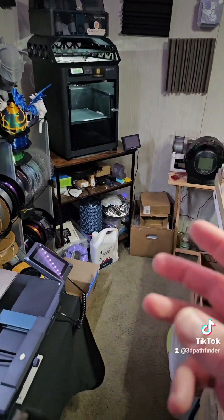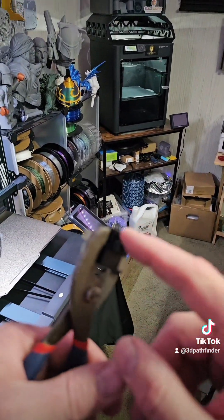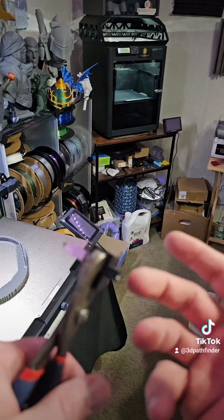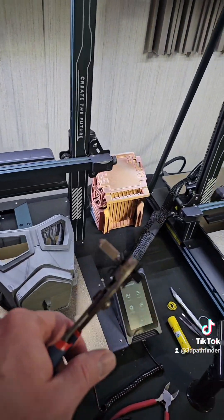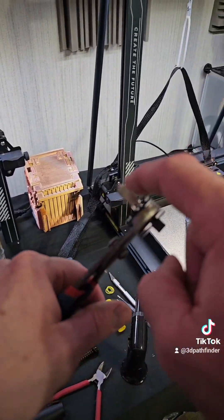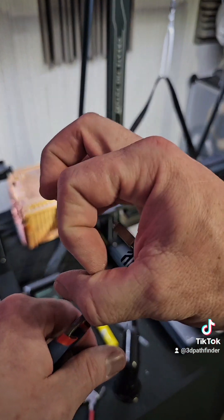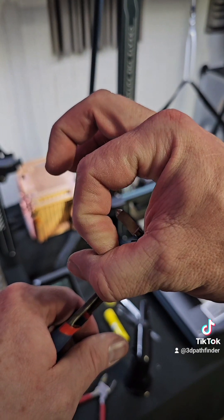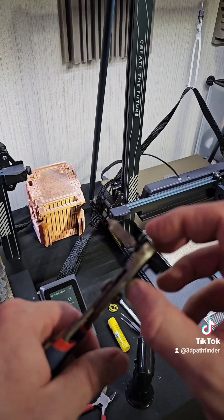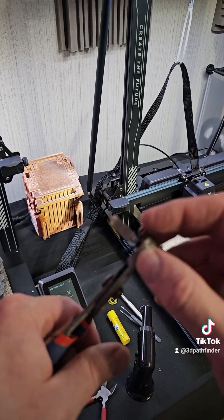Because I've got an entire box of nozzles that have clogged. When I need to, I get around to them and I'll unclog them this way. Probably better to use the torch, just because I can direct the flame right where I want it. With a heat gun, you have a larger barrel so you're heating a larger area. I try to keep most of the heat out of the heat break area, but you'll get some.